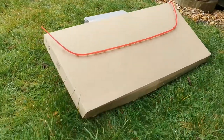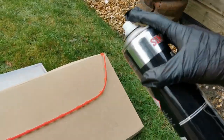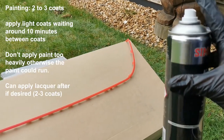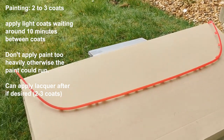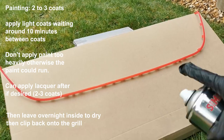I also put it on at a slight angle on the ground, because with the spray can, if we're spraying directly from above the paint doesn't come out the can very easily. It's better to hold the can as upright as possible so the paint won't splatter - that's why we've raised it up off the ground instead of just leaving it flat.